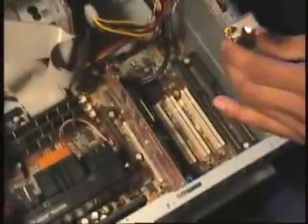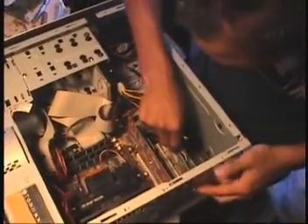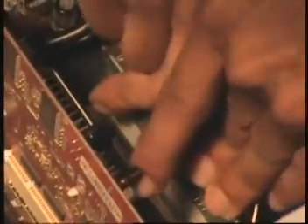What I got here is the sound card, so I'm going to go forward and set that one up too. I have this wire here that I want to connect with the sound card. And I'm going to leave that be as it may and slide this down into place. It's the same type of connection — PCI. I like PCI because it's pretty common in a lot of machines. That card is secure. Go ahead and pull the other screw into this.